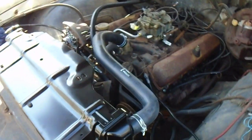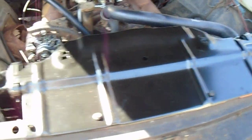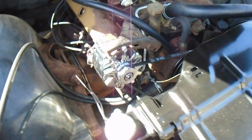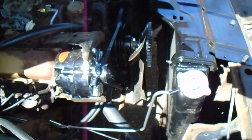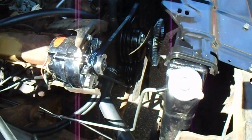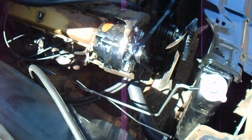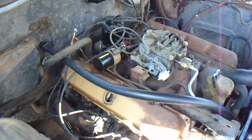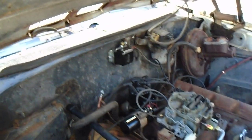New hoses, aluminum radiator that I had from a different project. Chrome alternator from a different parts car, but I knew it worked, so I threw that on there. Changed the pulleys, changed the harmonic balancer, changed the transmission cooling lines — they were really bad. I tried to bend one a little bit out of the way and it snapped. Got a coil in there too, new ground strap, and a voltage regulator.